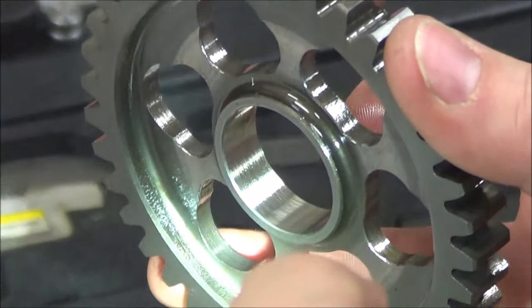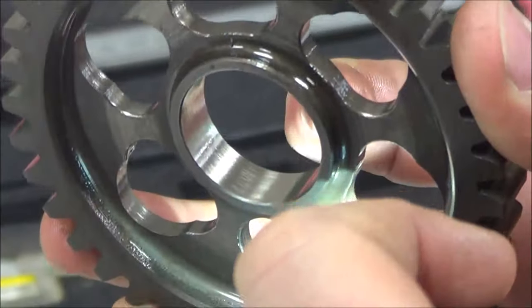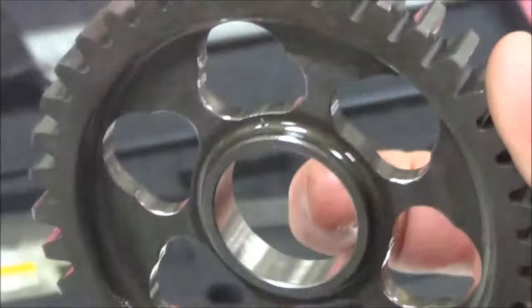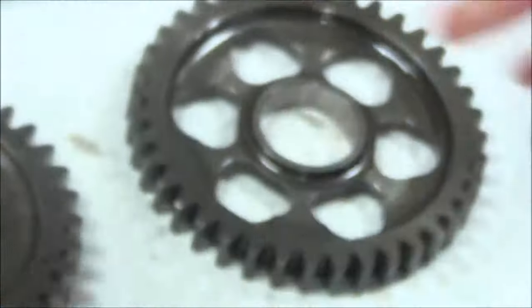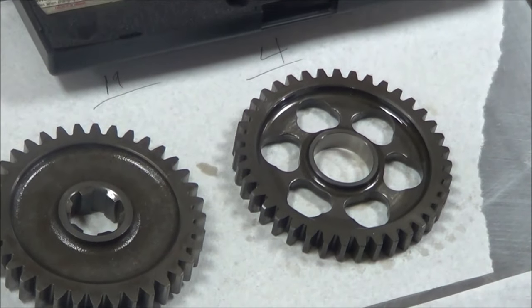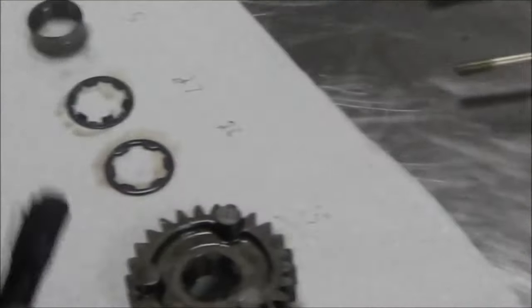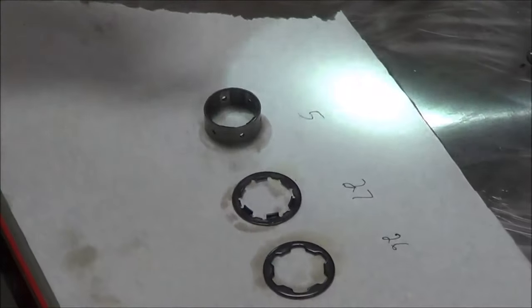What part of the engine does that resemble? — The cylinder. The cylinder honed, isn't it? Yes, it is honed. So what do we know about honing? It holds oil, 45-degree angle, precision. I like all those answers. So I'm going to trade places here and start to go down the transmission and keep doing some inspecting.